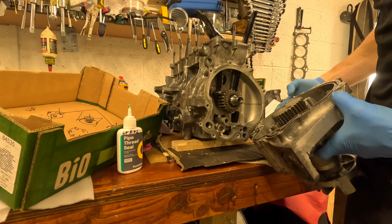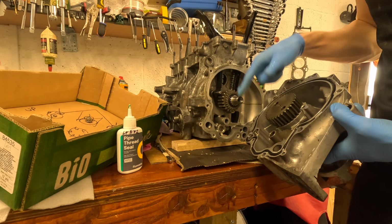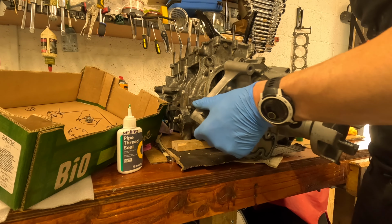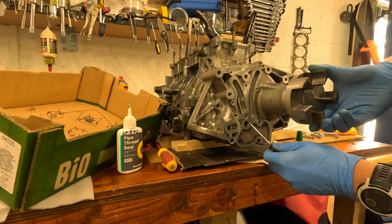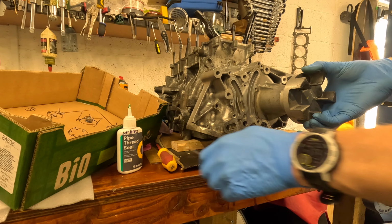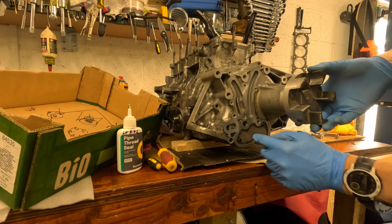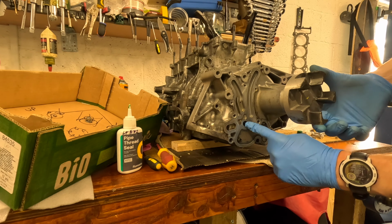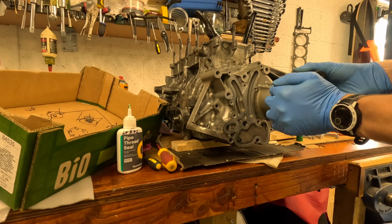When lining it up, it's important to line up your pin with your pinhole here, and obviously your main crankshaft into the main bearing. The rest of the gears should just fit together. You can rotate one of the gears through a T-head shaft here, which connects to the oil pump. That's what was stopping it clipping in. Now I've moved that, it's fine.